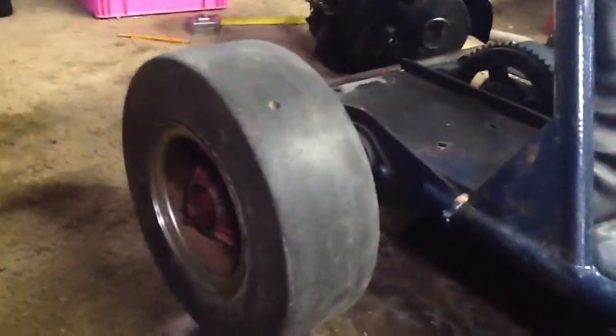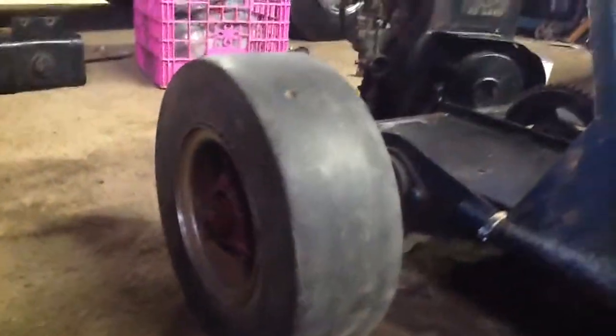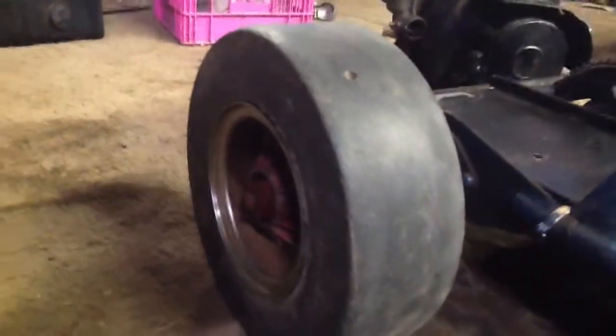I've been looking around for new back tires for this, and I can't find any that are a six-inch rim and are any taller than these with tread. So what I'm going to do is get a hub, a one-inch shaft hub, to go right there, and then I'm going to mount some boat trailer tires to this, so it'll be a bit taller and give me some more ground clearance. The ones I was looking at were 12 inches tall, so these are only 10, so it'll be a bit bigger and go a bit faster with a bit more ground clearance, because right now there's not much. When driving around in the yard, it might bottom out and do some damage, like it has done before to the previous owner, which I have had to fix under there.